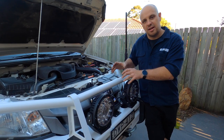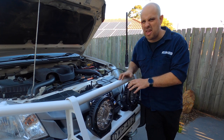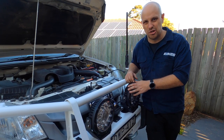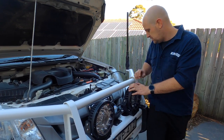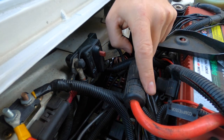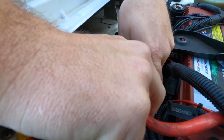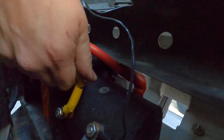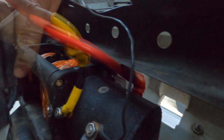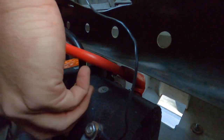The next step is to check the connections on the winch motor, because they can get knocked loose and come loose over time, especially if you've been working around there installing a driving light wiring harness and servicing your engine. I'm going to pull the grill out — or at least partway — so I've got better access down to the winch. Because we're operating in a tight space and using a spanner to tighten the connections, you must disconnect the power to the winch or you risk shorting things out by accidentally touching another terminal or a metal part of the vehicle. One by one, pull back the rubber isolator boots and check for cleanliness and tightness of the connection. If the connections are loose or dirty, carefully remove them one by one, clean up with sandpaper and contact cleaner, and refit. Make sure you wiggle the isolator boots properly back into position for each connector.